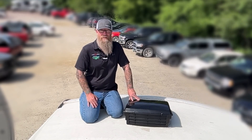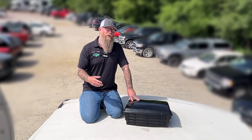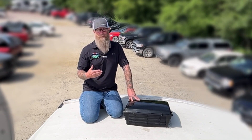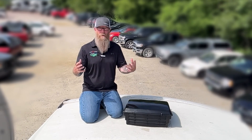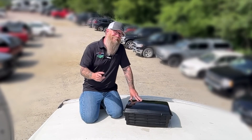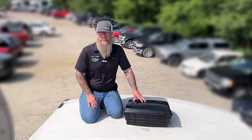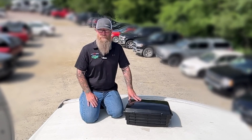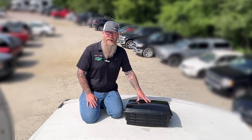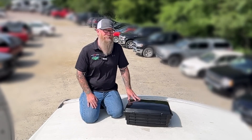Probably the most important thing — for a guy like me on the repair and service side — is letting moisture out. When we're in our campers camping, we're cooking, we're breathing, we're sleeping, we're taking showers. Every bit of that is bringing moisture into the camper. A typical family when they get home closes everything up tight, puts the camper in the backyard, and waits for their next camping adventure with all that moisture inside.